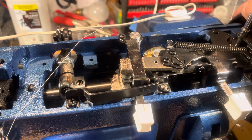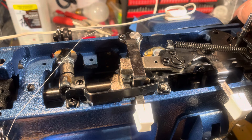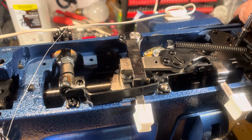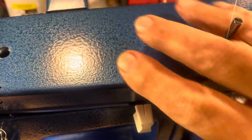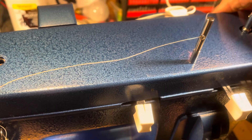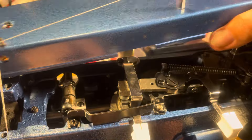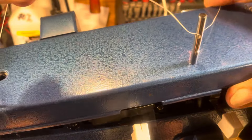Getting that back in, then you set the needle position — center, left, and right — so when your needle swings it doesn't hit on either side. That's pretty important. You want to make sure everything swings in the right spot. Then there's a setting underneath to make sure your top and bottom line up and get your needle close to the hook. It's got every adjustment you need. The new part was very crisply machined — the screw that holds the three needle position looked real nice. It didn't look grainy and crumbly like the original one that broke.